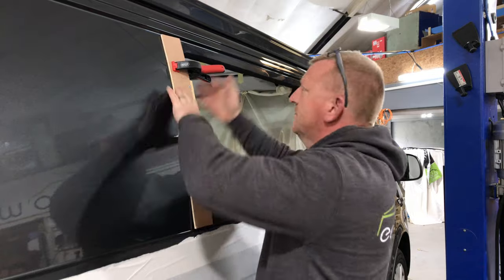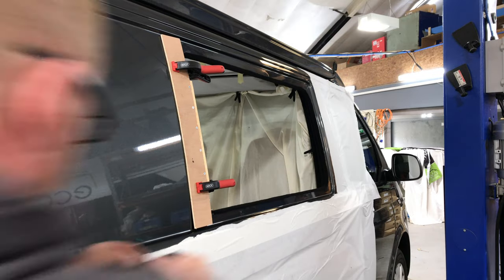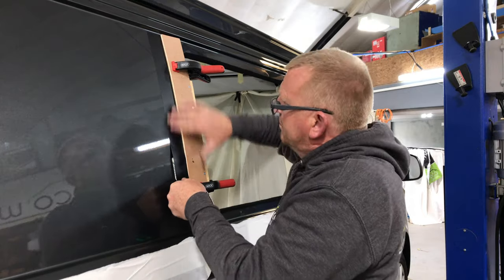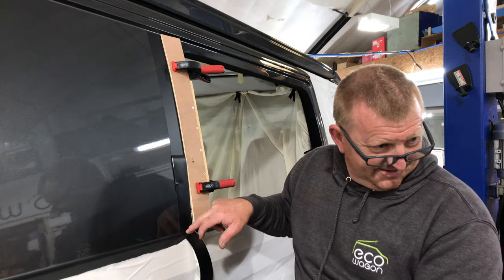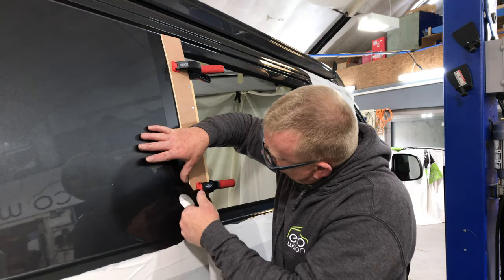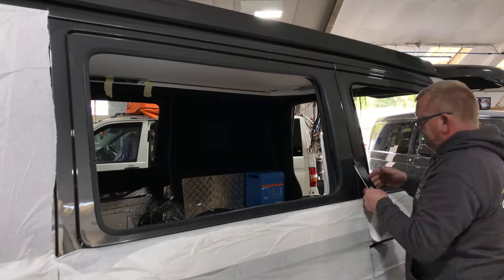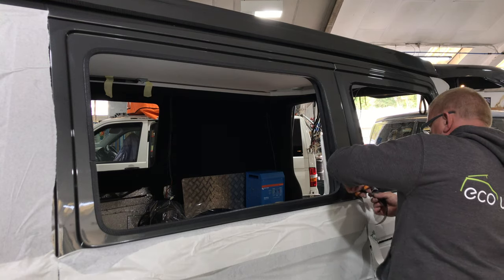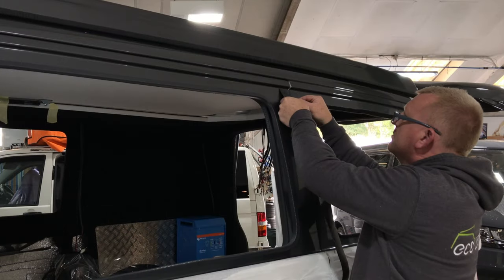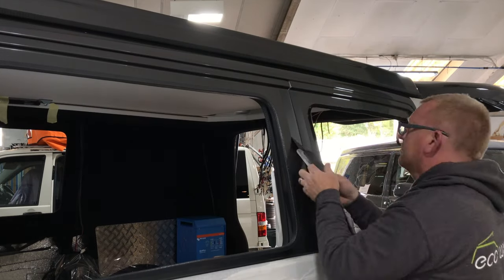Craig's putting a template, and this is for the matte tape. In between the glass you don't want to see the colour of your van. It's not so prominent on a grey van like mine, but say if you had a white van, the white line between the two dark glass windows does look wrong. So you put this matting tape on and it looks very sophisticated. Tiny little details like that matter, it's surprising.